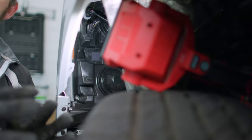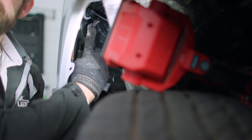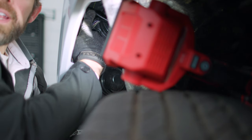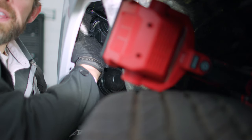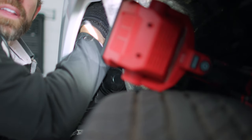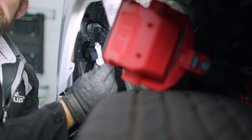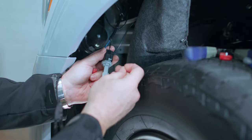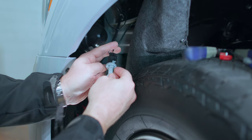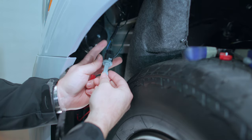It's difficult to show on camera because of the tight spot, but we've got it set up. This plug here is the power connector for your headlight assembly, and right above it, where my finger is pointing, this is going to be your front side marker socket. You can grab that socket and with a counterclockwise turn, it will release and you can pull it directly out. To connect to power for our Raptor grill kit, we're going to use this power and ground wire that's connected directly to the socket for our side marker light.